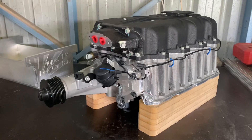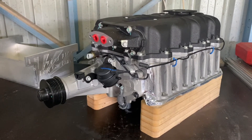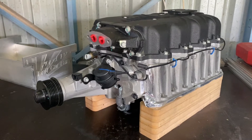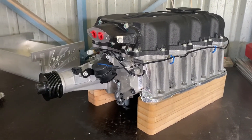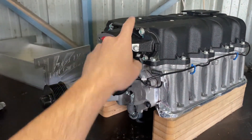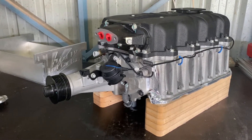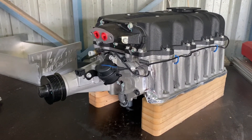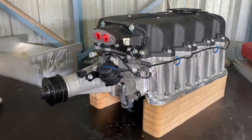The M122 — that's 122 cubic inches of air displacement, which roughly equates to about two liters, so that's quite a substantial jump up from the M90. This thing is also factory intercooled, using Laminova cores. If you know anything about Laminova cores, they're highly efficient, so this thing on the 1UZ would generate quite a bit more power and we'd be capable of running a lot more boost.